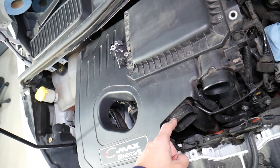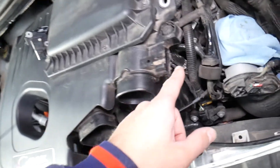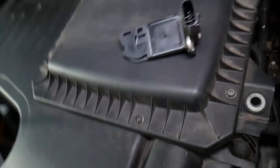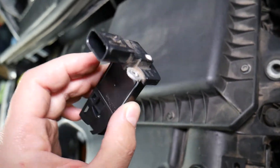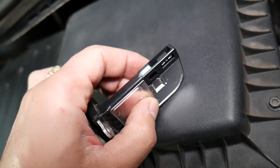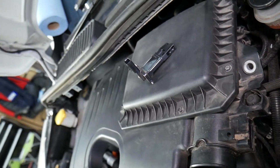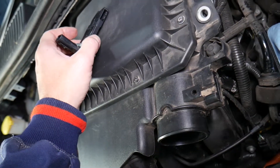From the grille it goes to here, then through the air filter, and from here it goes down to the throttle body. Right here on the side you're going to have one sensor. This sensor has a dual purpose — it's not just a mass air flow sensor. This sensor has two different functions: one of them is here on the outside, the other is on the inside. The purpose of that sensor is to detect how much air the car is getting — the volume of the air — which is the mass air flow function.